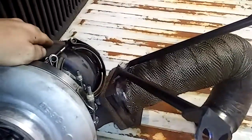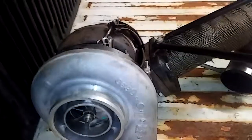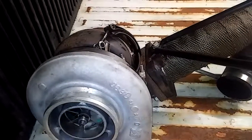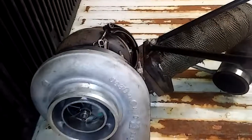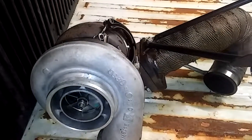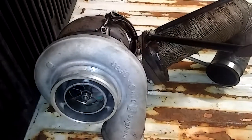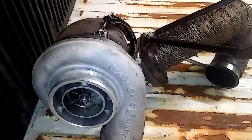We think we need to get a smaller AR on the hot side, though. This truck hauled ass, but it doesn't really come alive until above 2,500 RPM, so we're going to figure out how to dial that in to be more street-friendly. Once we get everything squared away with some smaller injectors — we think the injector was too big — we're now down to 250s from the 350s, so we should be good.